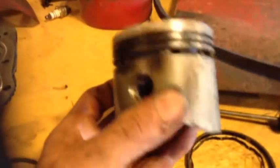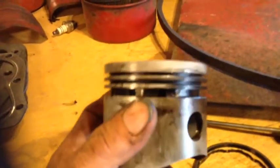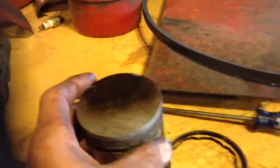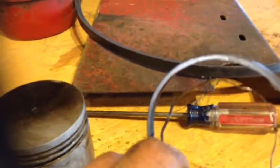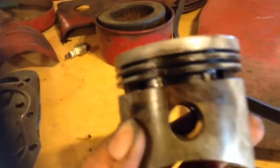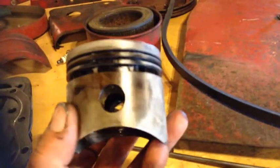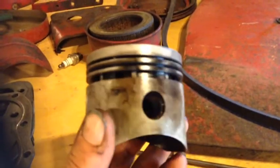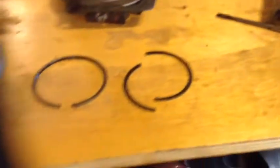It's like the oiler's built into the piston. I didn't see anything like this on YouTube. This is a two-piece — that's the oiler, I guess. All the other pistons I saw in the kits were solid-like. Well, more research needed. I broke two of the rings getting them out. I have to find a different way to do that.